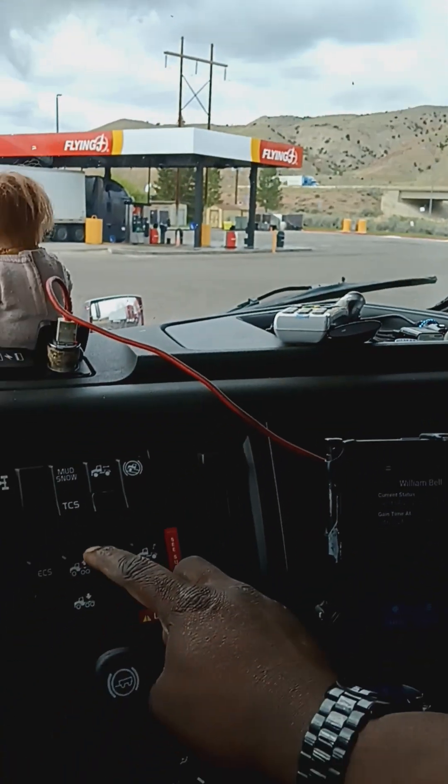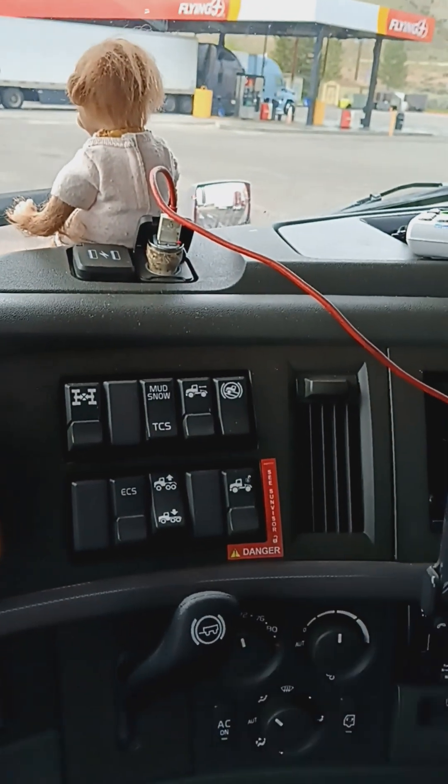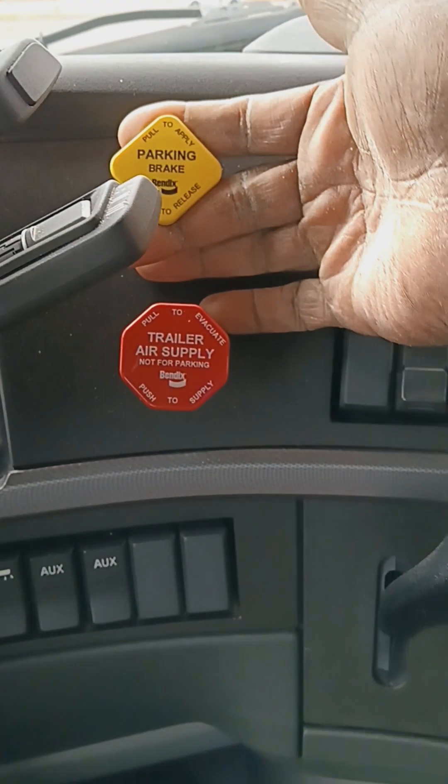May pull a little bit forward because I'm going to raise the truck. Now get my baby back up to the right height. We're back at our regular height. And once again, you always pull that yellow lock — that yellow knob. That's your parking brake. It's not like a car where you just put it in neutral and get out. I've seen that happen numerous times — drivers totally forgot, parked on an incline, and the truck rolls back into somebody else and takes off somebody's hood.